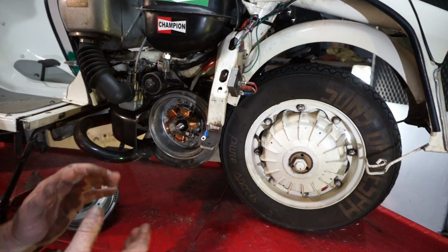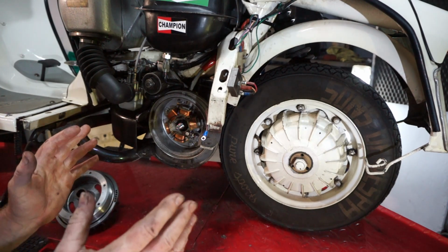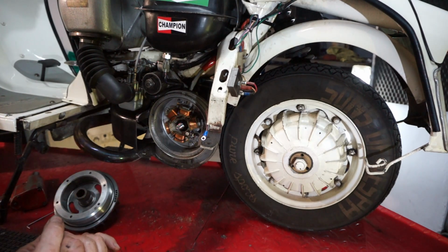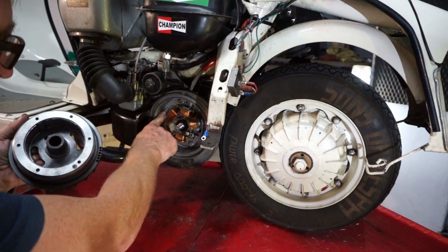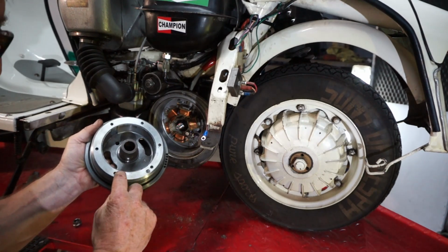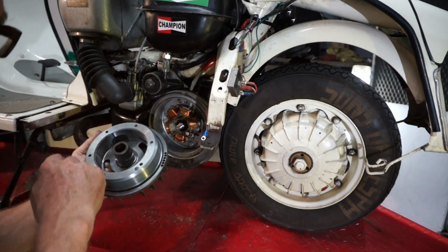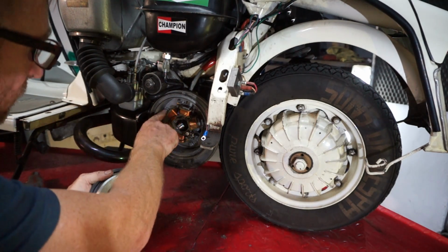Obviously, he knew a little bit about Lambrettas. He's got a few ideas. The bike's not bad at all. He's done a few things that are quite interesting. Although, he put some big washers on the back of the nuts on the stator, and they're just catching on the back of the flywheel. Just only slightly, but it's just there. So we'll do something about them.